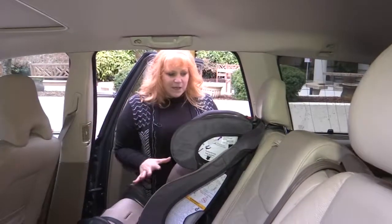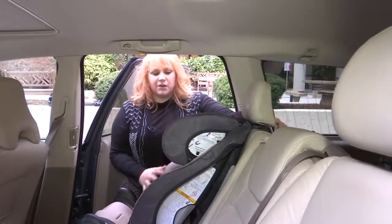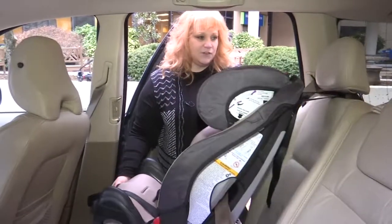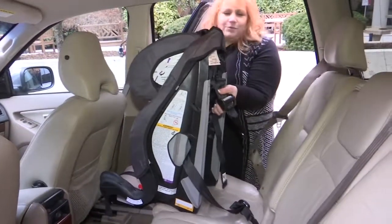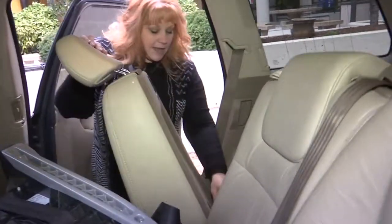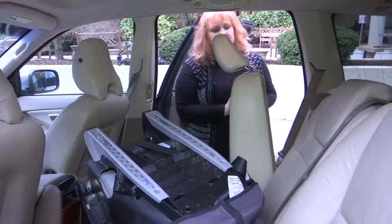In a forward-facing seat, once all this is done, a tether has to be used. In the event of a crash, we want that child's head and spine protected as much as possible. If a tether's not used, the seat's going to come forward, and you're going to be at greater risk for a head or neck injury. This tether strap is on every seat that goes forward-facing. A lot of parents, because it hangs back here, don't really know what it's for. It goes over the back of the seat — and this Volvo is very easy to use because right back here there's a latch, and that's what the tether connects to. All vehicles after 2002 that have the anchoring system will also have that latch. So regardless of whether you use the anchors or the seatbelt, you have to use that tether — it's hugely important for protecting their neck and their spine.